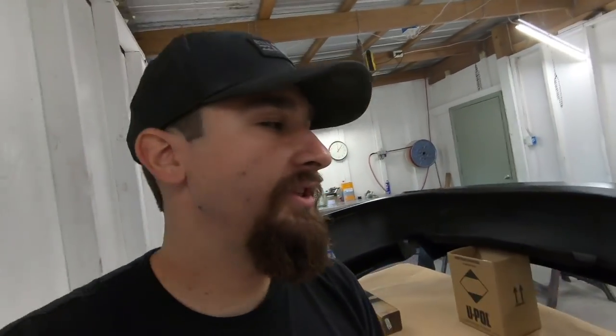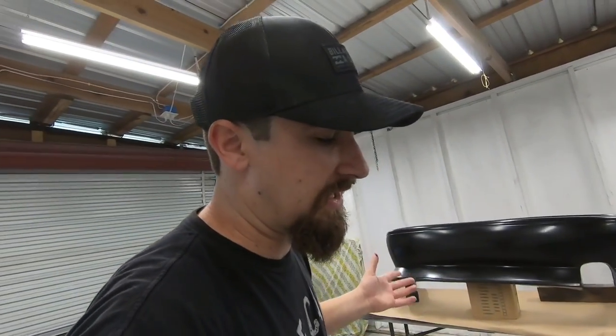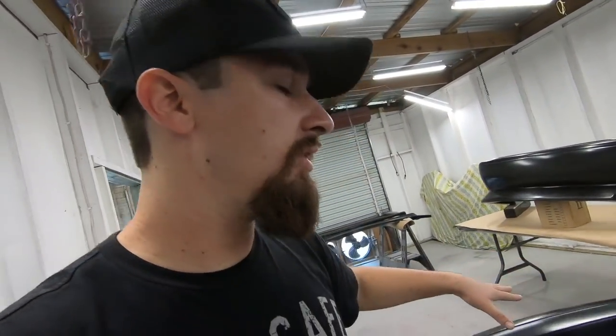So now the adhesion promoter's on there, and don't let this step scare you. It's gonna look bad. I mean, it's gonna look real gross, real funny, but this is basically a glue that's going underneath the base coat. So it's not gonna look perfect, but by the time the base coat goes on there, the flake layer, because keep in mind, this is Taylor Ray's car, so we gotta do the same exact flake mixture and then the clear coat on top of that. By the time all that's on there, it'll look just fine. So let's get this paint mixed up.